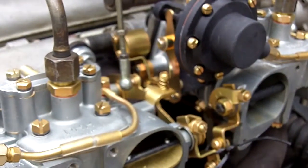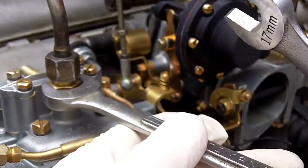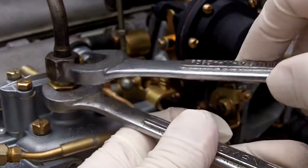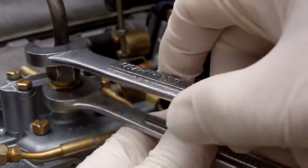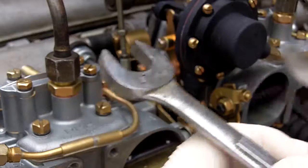When you're hooking up the fuel line, one of the things you want to remember is to hold this fitting in the float bowl cover stationary and do all your turning up here. You don't want to twist on this little fitting at all because that will ruin the threads right here.